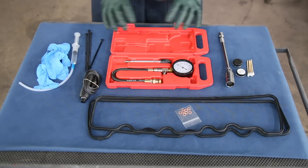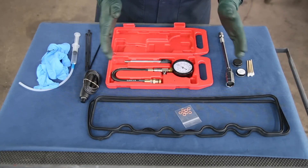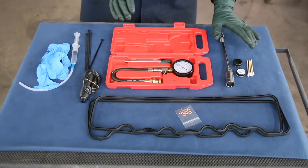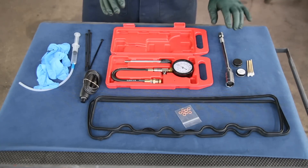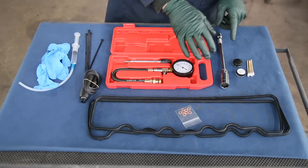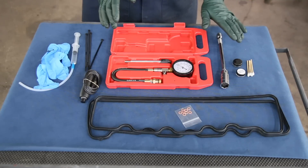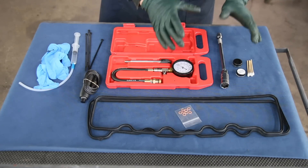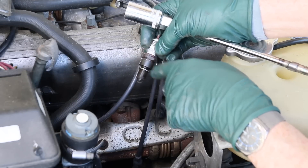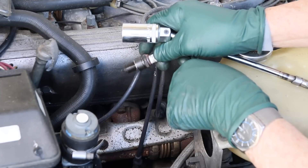Then you want to inspect the combustion chambers, the cylinder walls, and the pistons and piston rings. You can't do that visually, but there are clues — you do that by removing the spark plugs. I've got a special spark plug socket included in the kit; it's the best one I've found for getting the spark plugs out of all these older V8s. When you get the spark plugs out, inspecting them closely can give you a real good clue on how well the engine has been running, whether it's been burning oil, and how well the fuel injection system is working.